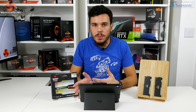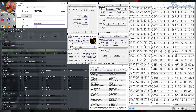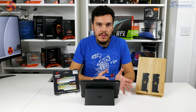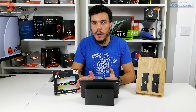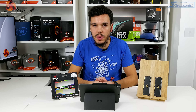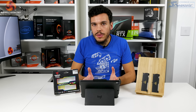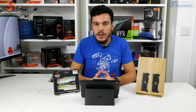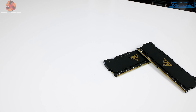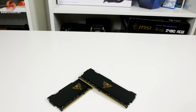Aiming for a balance between frequency and timings, we achieved 4000MHz 18-22-22-46 at 1.45V as the frequency-biased balanced result. For the timings-biased balanced approach, we managed 3800MHz 16-20-20-46 at 1.45V. That 3800MHz CL16 result was particularly good because it allows a 1900MHz fabric clock, giving you the 1:1 divider on Ryzen 5000 — pretty much ideal from an overall system performance perspective. While the out-of-the-box timings are lackluster, a quick tweak can get you something like 3800MHz at CL16, which is really quite reasonable overall.